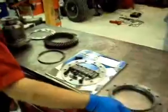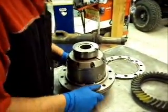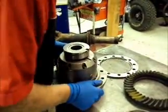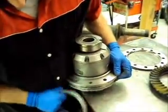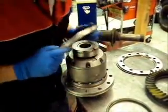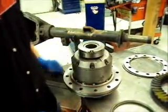If you're doing 70 gears, you would use this, which has a shoulder built into it. You'd use a 70 carrier, or you have to re-drill your 60 carrier. You can actually use this as a drill guide template to drill your 70 ring gear bolt holes right in between your 60 ring gear bolt holes.